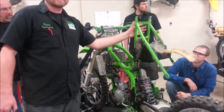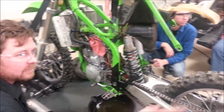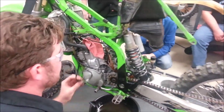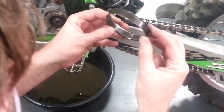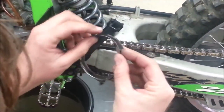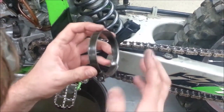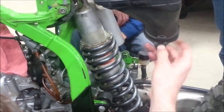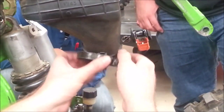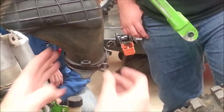That clamp went flying. I'm going to model how I think it should actually go, and I'm also looking at this clamp — it's just been violated. Get closer, guys — you can see it's bent, has screwdriver marks, and it's not in a good circle. It's pretty common. I would just replace this on a customer's bike so you don't have to deal with it. You could try to bend it back, but I'm going to look at this boot — a lot of times clamps are only meant to go one way and will have a securing tab. This one does not, so this clamp can go anywhere on there.